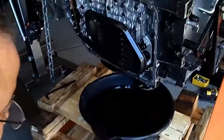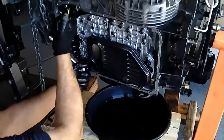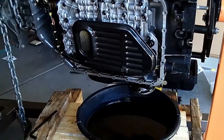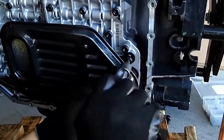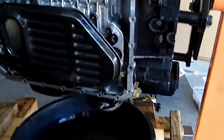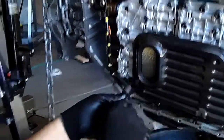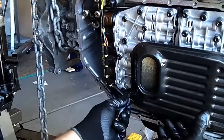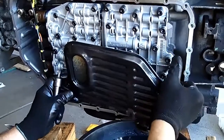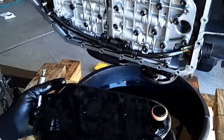I have to remove this filter. As you can see, it's a star driver. So there are 2 points you have to undo to pop the filter out. Alright, so I'm taking off the filter. It should be a short little piece. So all you gotta do is take the hex bolts out. Not hex, sorry. They're actually Torx. People call them stars. Really, Torx heads, and it should come right out. Should pop easily. There we go. Filter out. Done with the job. I'll be putting a new one in, and we'll move forward.